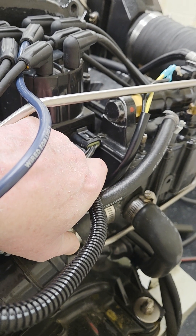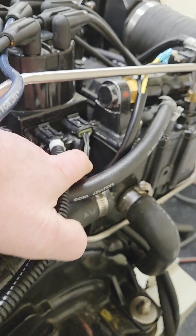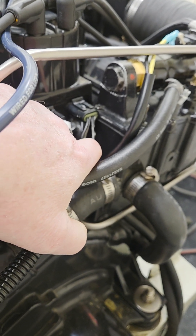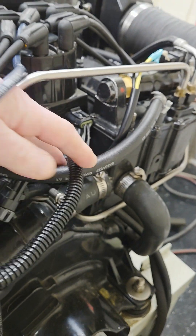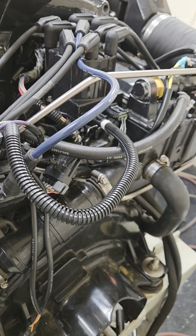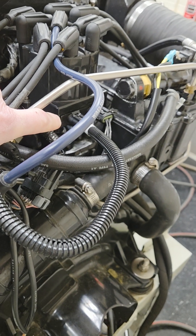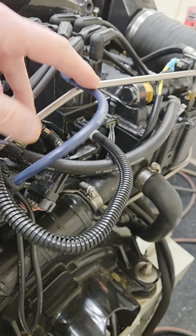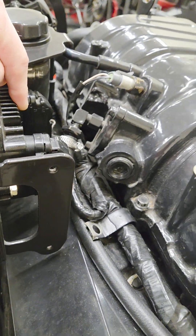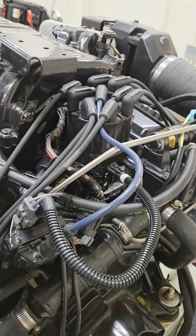You have a mirror-image reference low which is kind of a backup for reference high so the ECM has more accuracy. You also have your trigger wire, which is your IC wire, and your bypass wire. Those two wires are how the ignition module is controlled and how the ignition circuit is controlled to the actual coil from the ECM after the engine starts. Below 300 RPM the ignition module is creating spark - that's when you're cranking the engine. Once it fires and races above 300 RPM, the module is shunted off by the ECM, which then controls spark timing by overriding the ignition module, much like the shunt tool does during base timing.